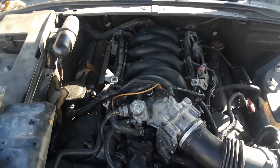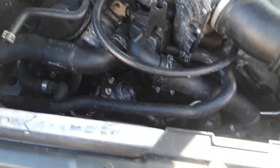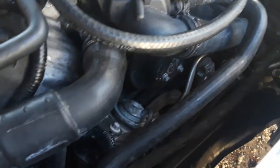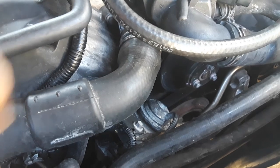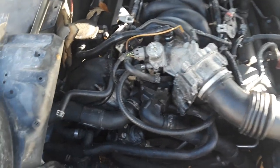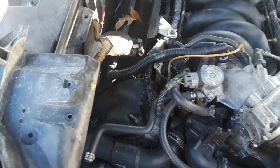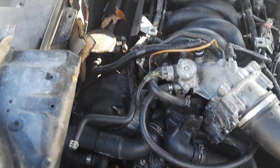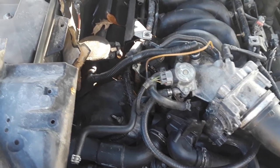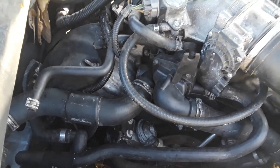Okay, let's show you. This is the pulley for the water pump — this pulley sits right on the water pump. I took out the water pump. This water pump has metal fins, which is actually the best version to get, because the ones that had plastic fins would usually fail. So this one already has the metal fins.